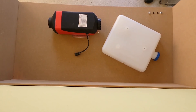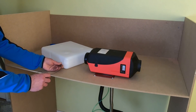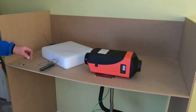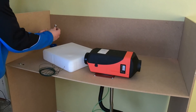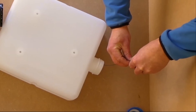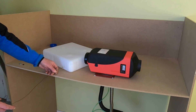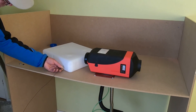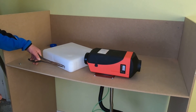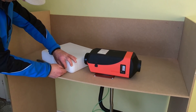Then we need a piece of flexible wire. Put the wire through the little hole until it comes out at the big opening. Now take the connector, put the first rubber on, slide it over the wire, and then bend the wire a little. Pull the wire in until the thinner part of the connector comes out, and then pull the wire out. Put the second rubber on and the nut - not too tight, because then you will damage the rubber.